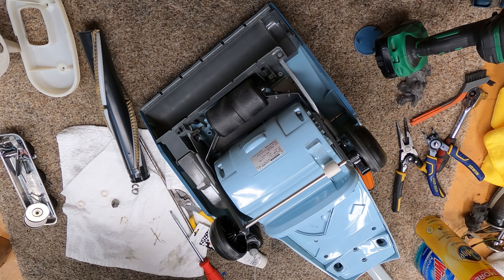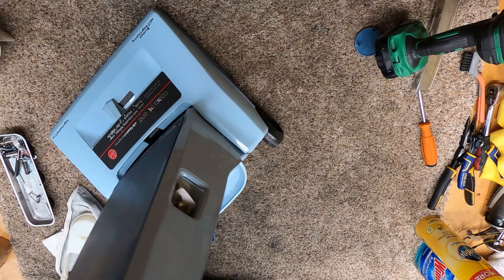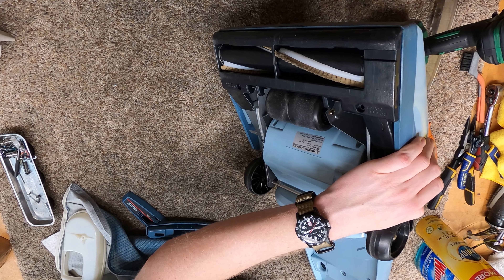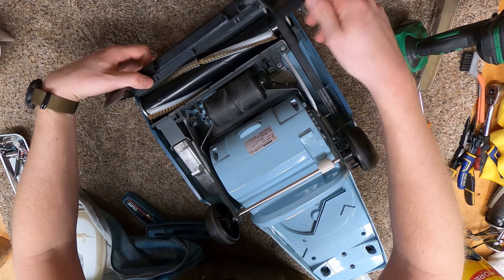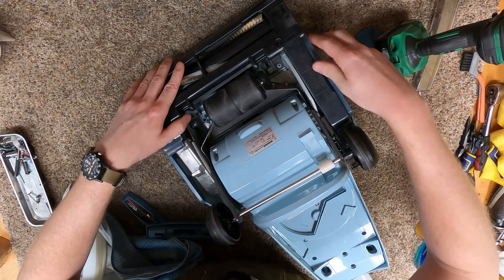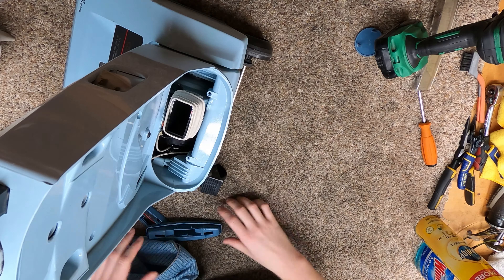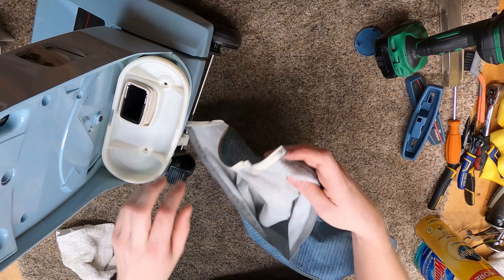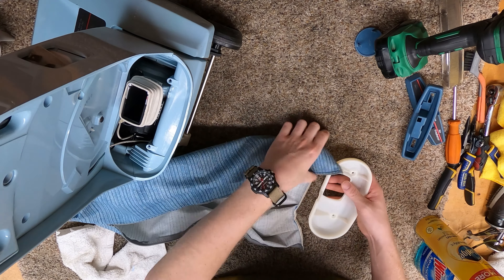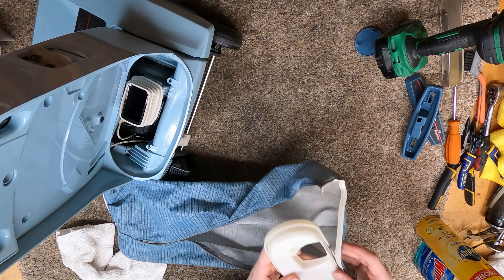I have a pretty new-looking roller — this was replaced at some point, would have been one of the last ones available because they've been discontinued for at least 20 to 25 years. I put it through the dishwasher and tried to wash it, even wire-wheeled it, but I can't get the blackness off — that's unfortunately permanent. So I'm just going to go through and rebuild these bearings. I think Hoover was trying to make it so you had to bring it in to change the brush roller. Sealed bearings had been pretty standard on equipment past the 1960s, so there's really no excuse.